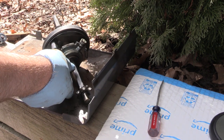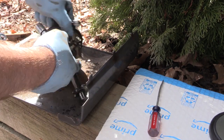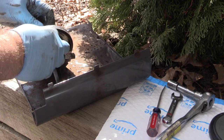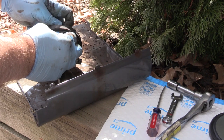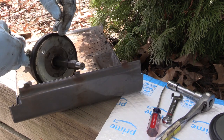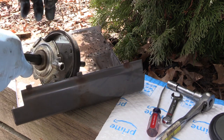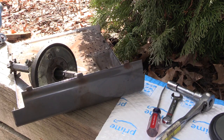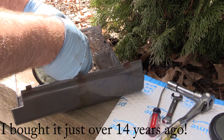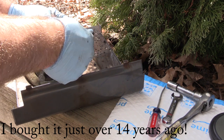This is a half inch — I'll have to go in from the inside. I need a short extension to fit my ratchet in between here. Loosen those all up first before I take them out. Now let's take a look — I want to make sure the bolt goes through the flat end, not the cupped end, and that we put this wheel back on the proper way.